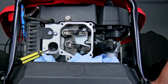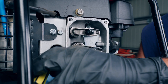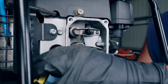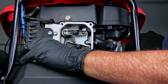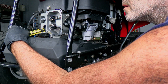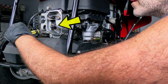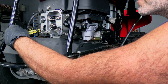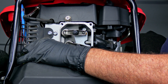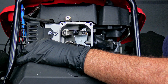I've gone ahead and removed the spark plug. Now we need to find top dead center on the compression stroke. When you push the clutch in and lock the brake, you release the belt for the drive so you can turn the engine from the bottom, since the top of the engine is kind of blocked off by these red covers. Grab the pulley on the bottom, and if you stick a screwdriver in the hole there, you can feel it. Notice the piston is coming up but this valve is down — so that's not the compression stroke. When you get to the top, you can feel a little bump in the crankshaft, and that'll tell you that you're right there at top dead center.